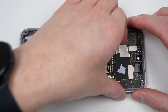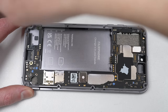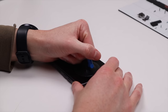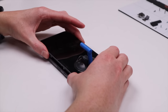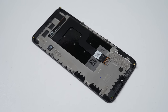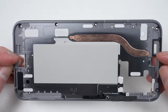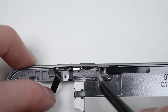With nothing visibly securing the motherboard, I tried to lift it out, but it didn't budge — we never unplugged the display, meaning its connector must be on the other side. To remove the display, there are 8 screws around the perimeter of the phone. Once removed, the screen can be lifted using a suction cup and plastic pick — absolutely no glue is holding it in place. With only 8 screws, the screen can be removed without taking anything else out of the phone. With the motherboard out, we're left with just a bare frame with the buttons intact, which are not intended for user replacement as evidenced by tape covering them and no replacement sold on Fairphone's site.